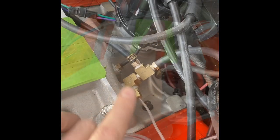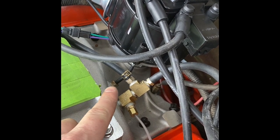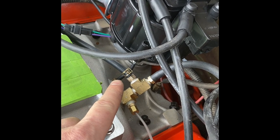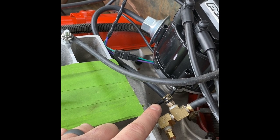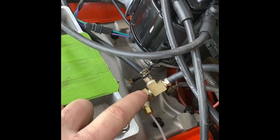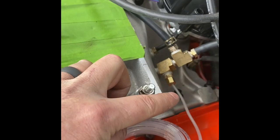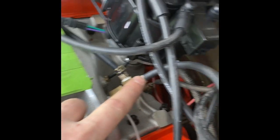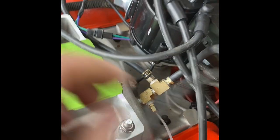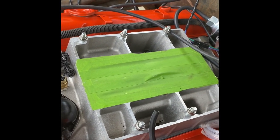Let's go to the back of the manifold — this is really why I waited to put the blower on. I've got the distributor in. I've got two manifold pressure ports down here that reference to different things. This single one down here references directly to the MSD box for the boost reference to retard timing based on boost pressure, and I can adjust that from in the cab. This little Rube Goldberg deal right here was the only way I could get four ports on here. The bottom one goes to my boost gauge, the middle one is the vacuum advance reference, and this one is the boost-referenced carburetor that I'm about to build and put on here.